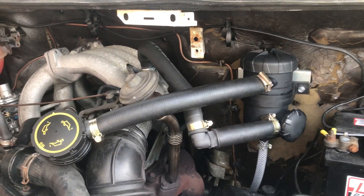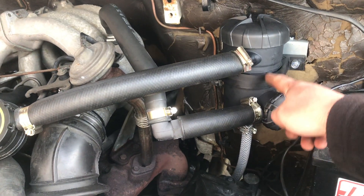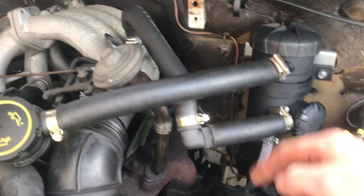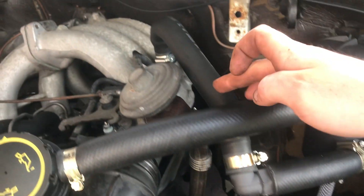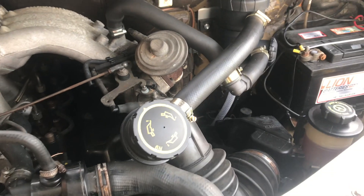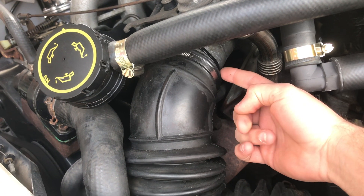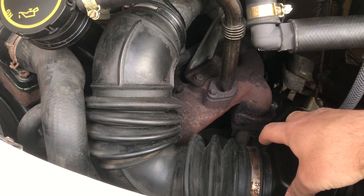That's it all installed. The crankcase breather pipe goes to the filter, any oil is caught in the can before the air enters back into the engine, and there's a drain pipe with a valve right at the bottom of the van. It looks fairly factory, none of the pipes are touching, there are gaps all around, and I reused the existing hose so if I ever want to remove it and return to standard I can do so quite easily. Another problem with these engines is oil build-up inside the inlet manifold which drains back down into the air filter housing, leaving oil sitting on the air filter.